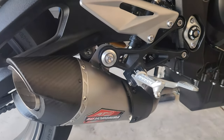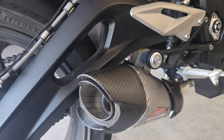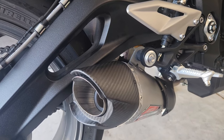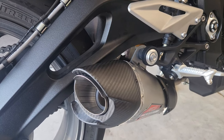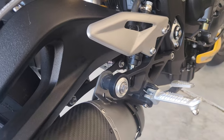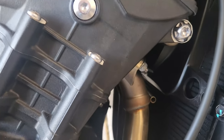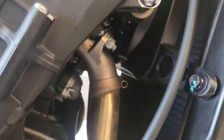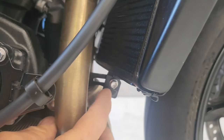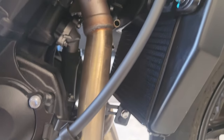It's not a hard job - it took me 40 minutes even while talking on camera. Super simple. I got the Yoshimura slip-on for a 2019-2023, because the 2023 US models are the same as the 2022 anyway. Even though it's supposedly not an exact fit, it fit exactly. The 2021 header from eBay for a couple hundred dollars - you can't go wrong. The nuts and bolts are easy to get to; you loosen this clamp, take this bolt out, move the radiator forward, and the header drops down. Piece of cake.